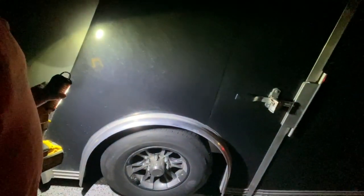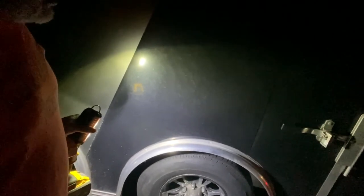This is my third stop here trying to fix this thing. Tire pressure monitor's indicating it's still losing pressure, so I'm back out here trying to keep this tire afloat so it doesn't blow out on me. I might have to stop and just plug it, get one of those plugs. I don't think I have one, but I could double check to seal this up, because this sealant's not seeming to take hold here like it should. By the way, I am right outside of Mesquite, Nevada.